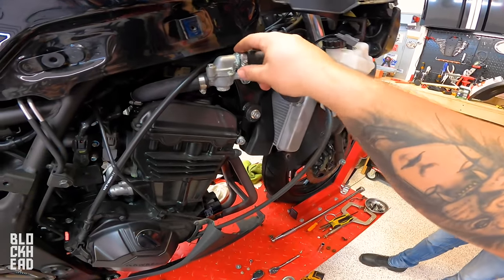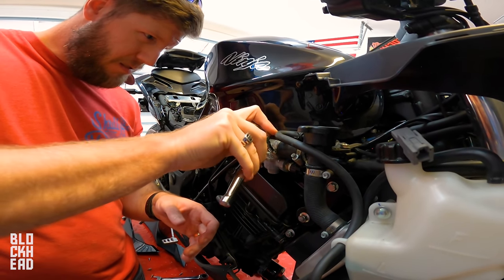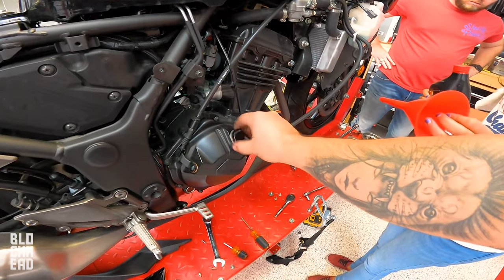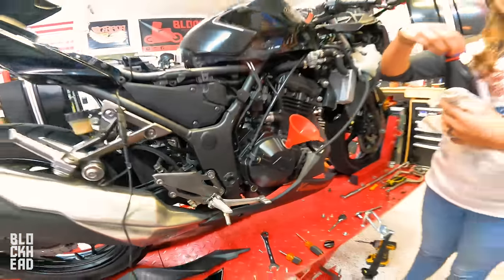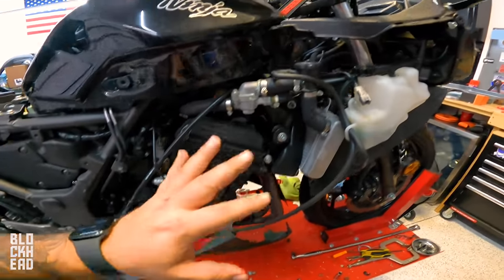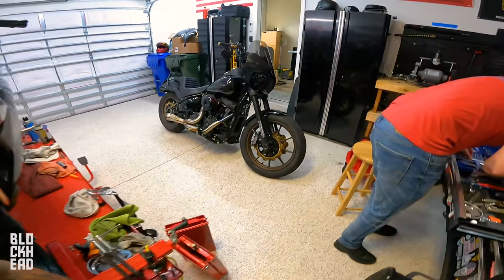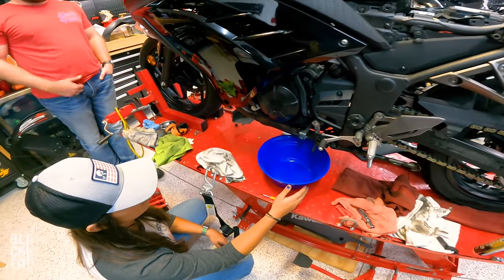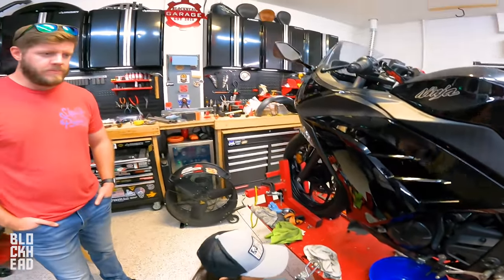With the fairing removed, we've got a little bit of coolant dried up and built up here — so that's something to keep an eye on, just tighten those down. The coolant is pretty low so we're going to go ahead and add more — the system takes about 2.3 liters normally, 2.5 dry, so it's pretty concentrated. Oil is done. Now doing the coolant. Since we've got the fairing off, we have access to the reservoir. To drain the coolant it's going to be this bolt right here, and to catch it we've got this bowl.